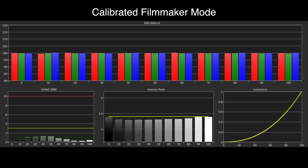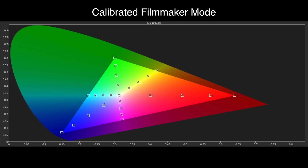We'd like to see better gamma tracking in future updates. The Rec 709 results post-calibration are good, with red now tracking correctly saturation-wise from 75% downwards, though 100% is still oversaturated. The other points are there or thereabouts with very small overall errors in hue and saturation — indeed, no errors higher than delta E 2, well below the visible threshold of 3.